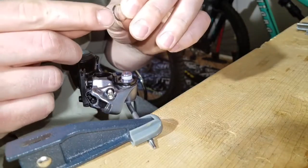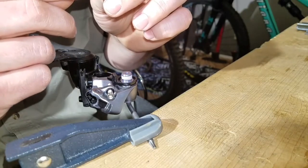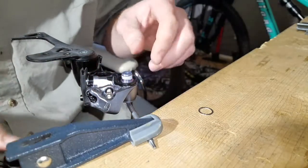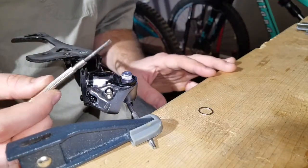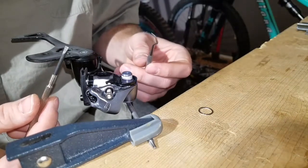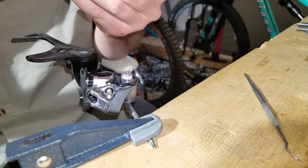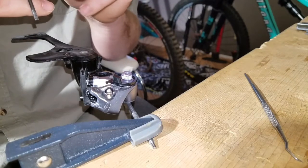This is the part that's kind of an arduous task. It's a split ring, and you have to get it started in the groove while you press the plate down to expose the groove, then work it around. Online they have a pretty good method — they use a flat blade screwdriver. I've done this multiple times using dental picks and flat blade screwdrivers. An extra pair of hands helps. I'm going to try just using a flat blade screwdriver today, as that's what the SRAM manual recommends. Having a video on this would be very helpful.